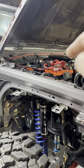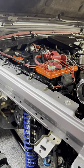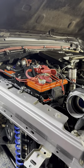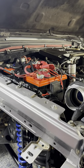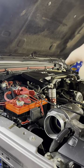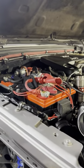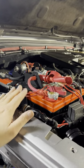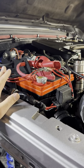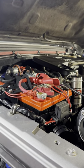If you have the dual battery — Genesis dual battery setup — you cannot use either one of the brackets that comes with the 3.6 gas version of their kit. I actually took one of their brackets and cut it to fit over there by the coolant reservoir, which I'll show you in a second. Their harness is long enough to mount it wherever you need to, other than power and ground, so you can put it over there and everything that goes in the cab still fits fine.